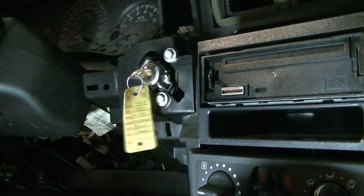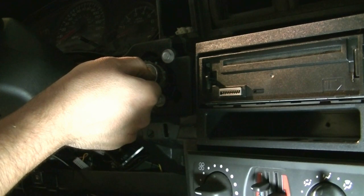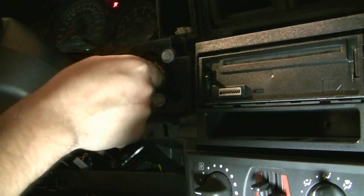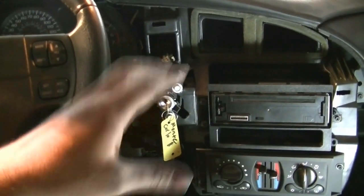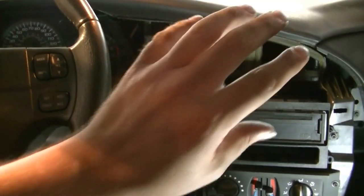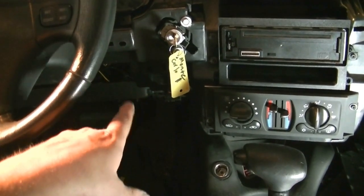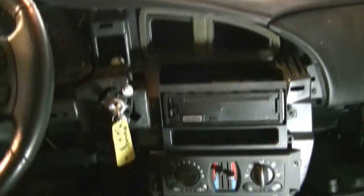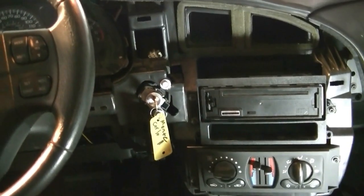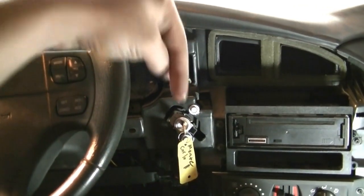The car was out of battery, so I put the charger on it. Let's try this again — there we go, works perfect! For the rest of the video, just put back everything you took off in reverse order. Put on the plastic piece, reconnect the emergency flasher connector, then the metal kick panel, then the plastic panels. Don't force anything, don't forget the screws, and take your time. If you're forcing something it means it's not lined up correctly — just make minor adjustments. Hope this video helped. If you liked it please give a thumbs up, leave any comments below, and I'll see you next time. Thanks for watching.